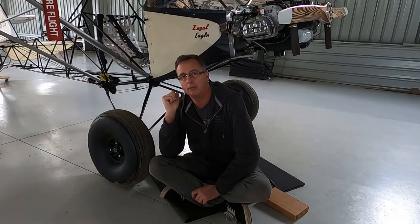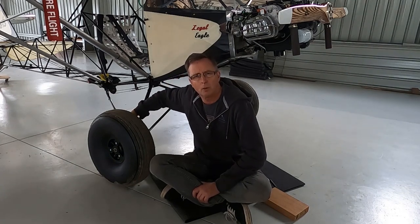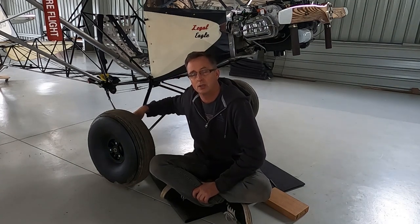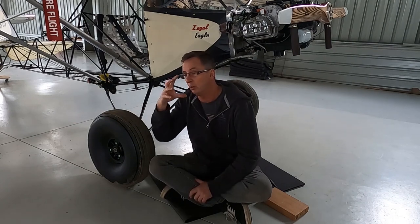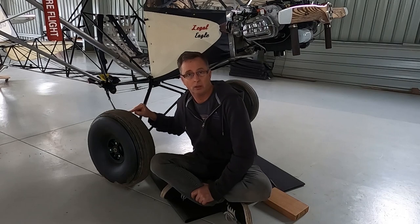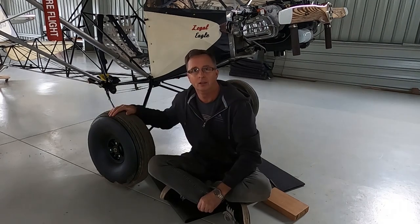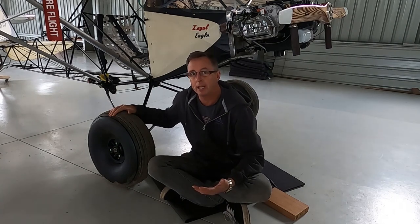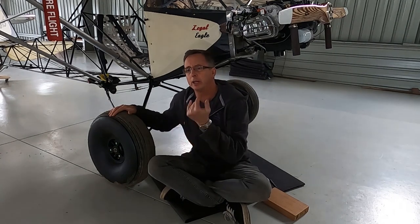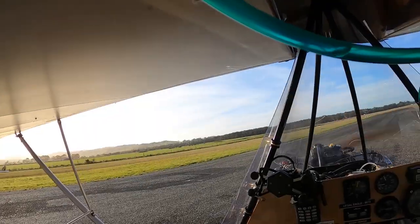Taxiing along, it takes more force to slow the aircraft down on the brake lever itself. In so doing, I managed to pull the cable — it wasn't done up quite tightly enough on this particular side. So before I'd even taken off, I'd already pulled the cable through a little bit. I really didn't have much braking on the right-hand side. I figured I'd only need braking anyway for taxiing and ground handling.